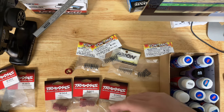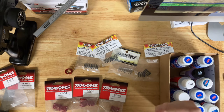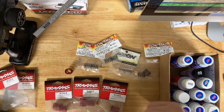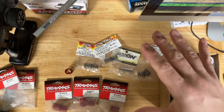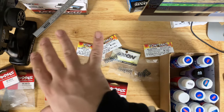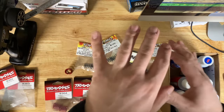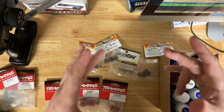The goal for that car was to test motors, not springs, which is why I kept the same setup. If you look at it, it rolls a lot and just cruises. Now if your springs are too stiff, one of the things that's going to start happening is you're going to start either traction rolling or just sliding. If the car pitches a lot — just goes left and right a lot and feels slow — start stiffening the springs, starting with the front.